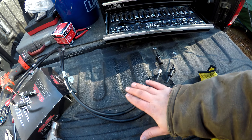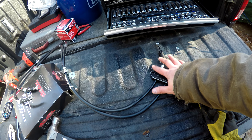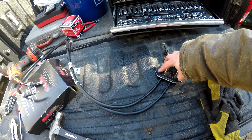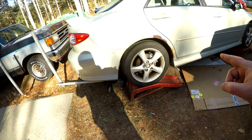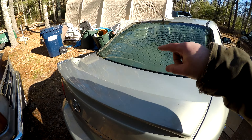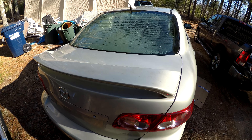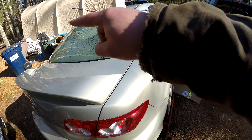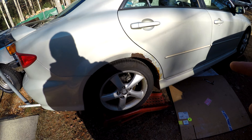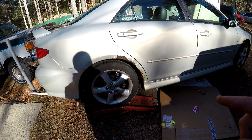What we need to do now is take the exhaust shield down that's covering this piece here. There are two bolts and we'll get those out. Then I'll move back to the back half of the car. There's one more bolt on the driver's side rear that I have to pull out on the control arm that holds the cable up over there. And then it's one bolt on each caliper to disconnect the emergency brake cable from the caliper.